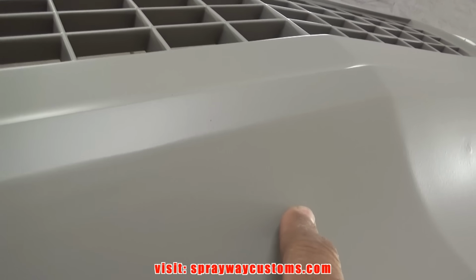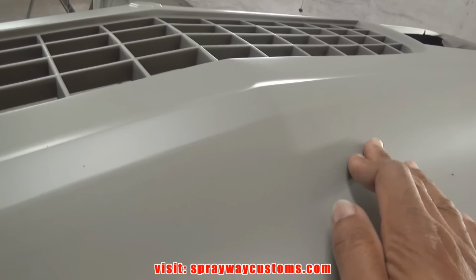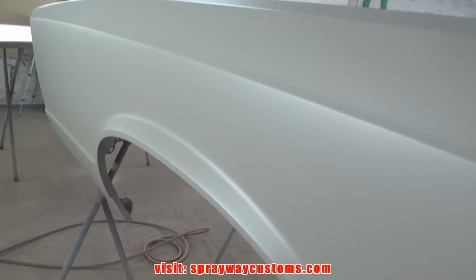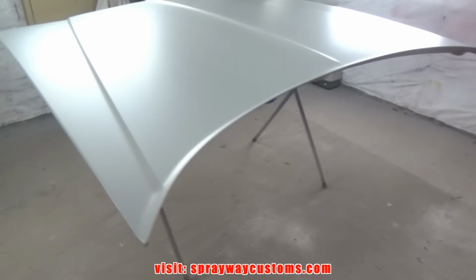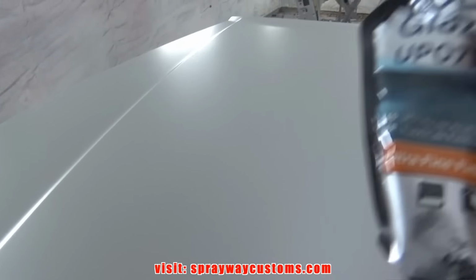See, you can see my holes that I filled. I'm thinking that can be blocked out also. Stretch here, but I'm just gonna go over it. Let's see, have to fill this area here with some glazing putty. I'm just gonna go over everything and fill it, then I'll cut you back in once I get done. Well, let me show you what glazing putty I'm gonna use. I just use this Dolphin Glaze, wipe a skim coat on it, then I'll be good.